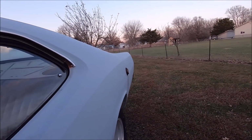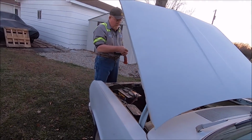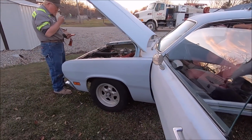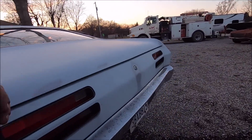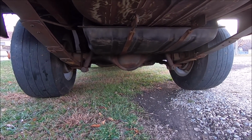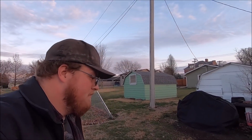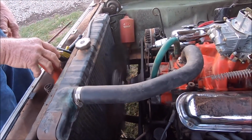There's still a little something there. Just temporary carburetor. Bring that idle on down to about dying. Let's hear what it sounds like back here. Survey says eye melting rich. Wonder how your floats are. Oh! My eyes are still in pain from that one. Yeah. This carburetor must have bigger jets than the other one.